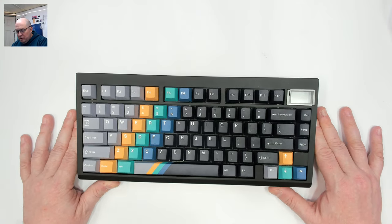All right, so it's not the easiest thing, but the way that I did it was, you can see the inside of the clips under here, and I basically pressed on one, held it out a little bit, to where I could at least get my spudger in there. Now I can go ahead and start undoing the rest of the clips.